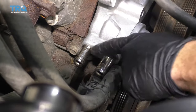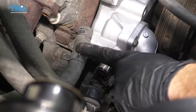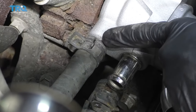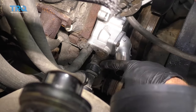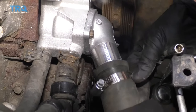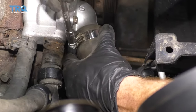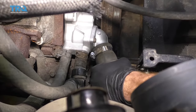Now it's going to be time to get our hoses on here. You're going to notice that the one towards the rear of the vehicle is smaller in diameter than the front one. Take the single hose and put that one on the rear, then take the one with the Y and put that towards the front. Make sure you still have a little bit of hose sticking out past the end, and put the clamp back roughly where you got it from on the hose itself. Give both hoses a nice tug — make sure they cannot slide off. If they slide, you need to replace your clamps. Double-check your clamp, make sure it's in good condition; if not, go ahead and replace it. Slide it all the way so it bottoms out, then snug up your clamp. Give it a nice check to make sure it can't spin around and isn't sliding off.